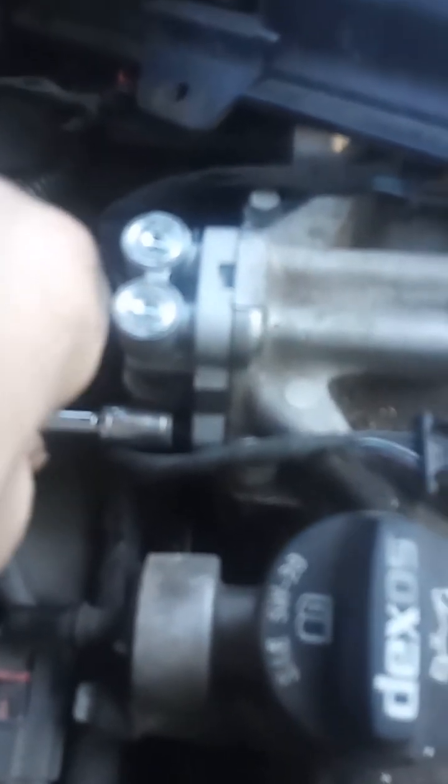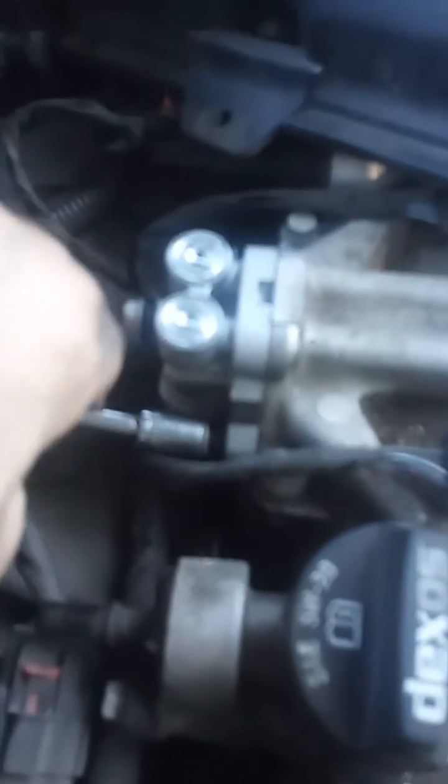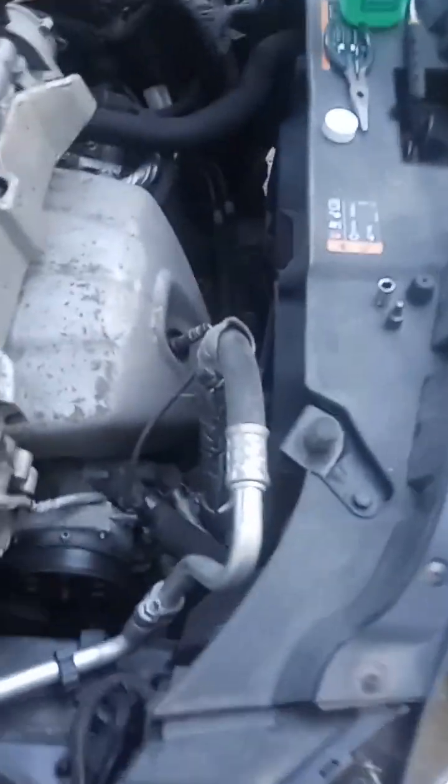Now, they're going to start getting tight when they get down to that plastic piece. It looks like that plastic piece does act like some kind of gasket. Under most conditions, you should replace all gaskets. Like I said, GM's literature didn't mention replacing the bolt or that there was a gasket on the bolt. Dorman comes with no instructions. So what I will need to do is check my oil level regularly to make sure I do not have an oil leak after I put this part in and get this car started up and running again. All right. They also might just prevent you from over torquing the bolt.